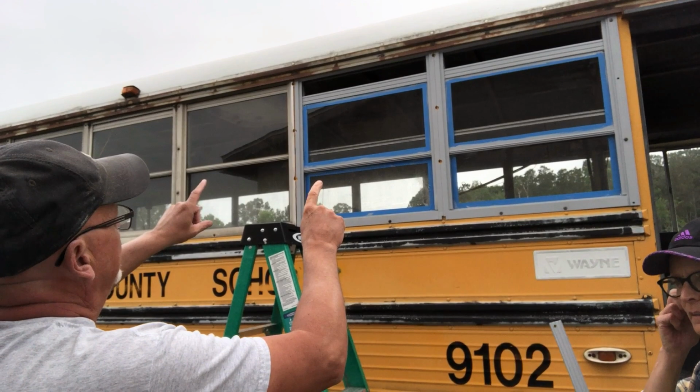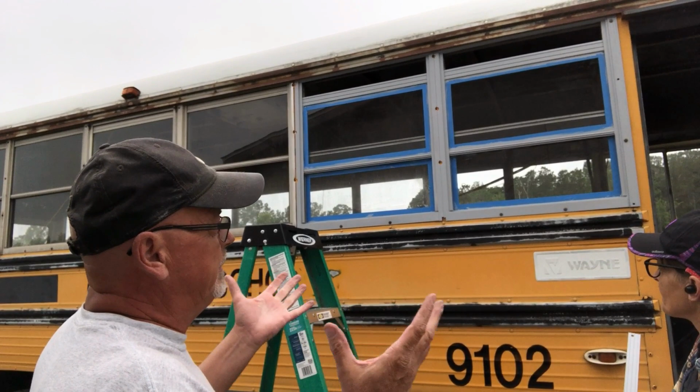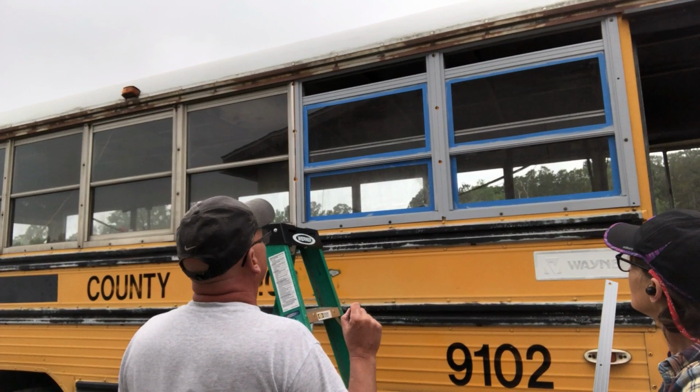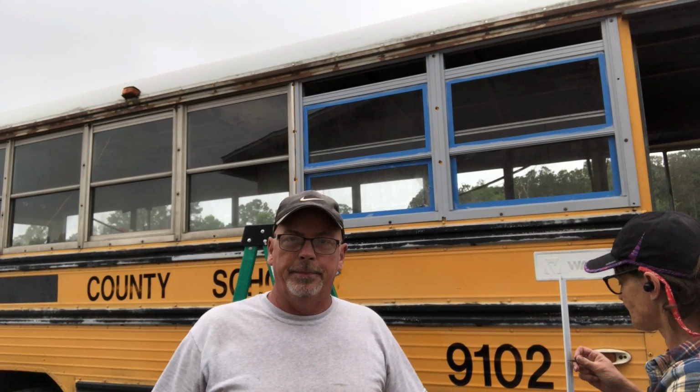You can see Tracy got the two windows. She got the latches fixed in both of them. She used the aluminum primer. It's self-etching, basically, because aluminum won't hold paint or primer. It'll peel. But if you use a self-etching primer or a primer made for aluminum, it turns out looking pretty daggone good. She didn't have time today to get the black paint on them because we're just running out of daylight. It's been a cool day.